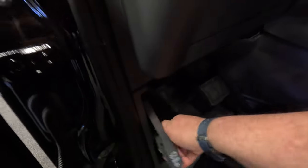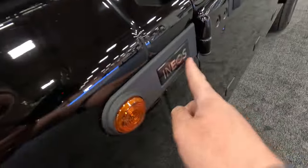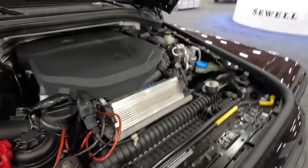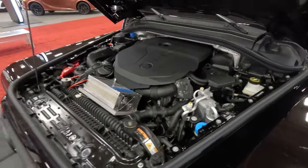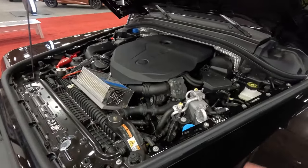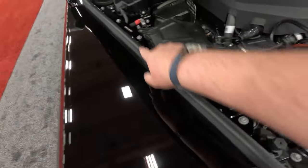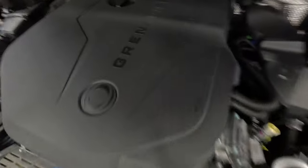Time to check out the powertrain. I love that the hood is embossed with 'Grenadier' and then you've got 'Ineos' on this side. There's not a vent on the driver's side, but there is on the passenger side. When we open it up — it is not a strut system, it is a rod. This is the B58 inline-six that BMW uses these days, and behind that is a ZF eight-speed, which is just a killer transmission and an awesome powertrain. Think of this as a German 2JZ. Look at this weather stripping all the way around the full perimeter on this hood and also up on the cowl — this thing is just meant for water. Something tells me that vent is meant to feed the air box right there. It has its own engine cover and it does not say BMW on it, but much like a Toyota Supra it says it on the throttle body because it's the same architecture engine.